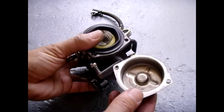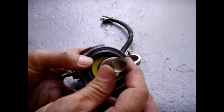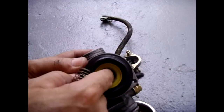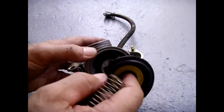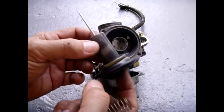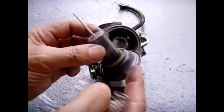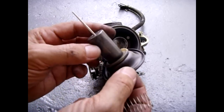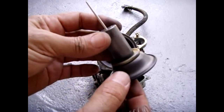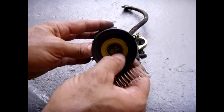The top has been taken off. This dimple in the cover goes into that spring. The spring puts pressure on this diaphragm. Now what you want to check: you want to slide this out. It looks like that — there's a needle on it. Inspect and hold the flashlight behind this, or go outside in direct sun, and make sure there's no cuts in this diaphragm. If after inspecting this you don't find any cracks or any dried out areas, you could reinstall this because there's nothing else in this area that you're going to want to check out.